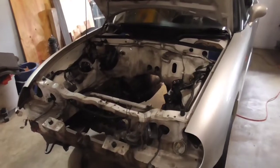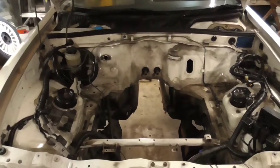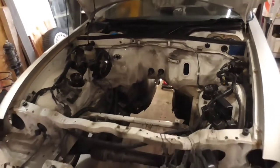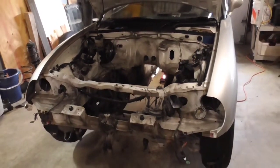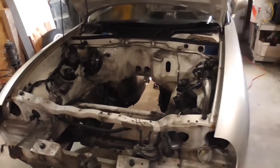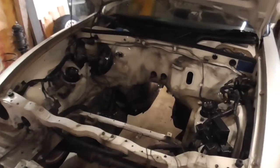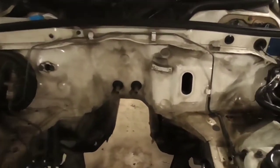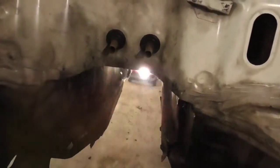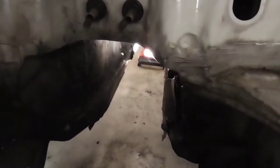So I did a bunch of research and I found out a bunch of information about what we're going to do here on the project, and I went ahead and ordered a bunch of parts for the project. So I think I got it all figured out here. I'll go into detail about that later when those parts arrive. But basically the overview is we're going to have an air-cooled AC motor, it's going to be full regen, it's going to be a Curtis motor and controller, and it's going to be going right down there.